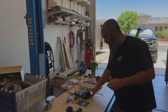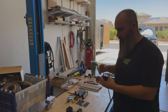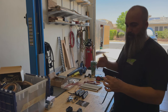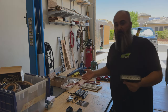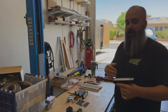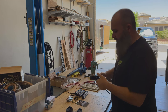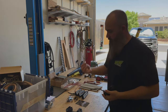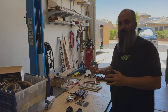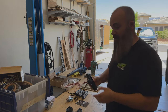My plan is to start with the flood lights first. I have a door on both sides of the trailer and I'm going to mount them equidistant from the same spot in the middle. I'm going to go two bays forward of the front axle. I'm just going to try to get spread near both of my doors. And then in the back, I'm going to mount them on both sides of the rear, facing down at my ramp door. These guys come with a little bracket and some hardware to go through the side of the trailer. So what I'm going to have to do is start by at least locating and drilling through the side, which is always fun to drill through a nice watertight trailer.